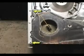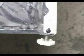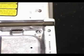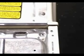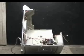Remove these two screws and remove the front leg, and remove the screw from the bottom. Remove the back leg and remove all the screws all the way to the top. Use a screwdriver to unhook the panel. Do that on both sides. And remove the side panel.